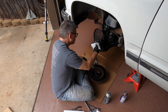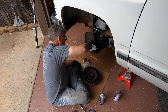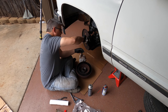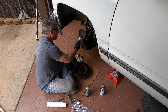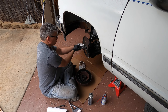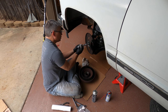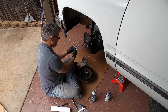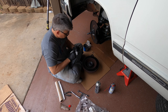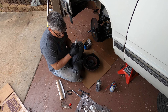One side of Betty White went together really easy, the other side not so much. This doesn't make it go any faster, but it will cut down on wear on the passenger side front tire, which was pulling to the right tremendously — hasn't been aligned in years. It's going to sit a little bit lower and look good when finished. One person could probably do this job; two makes it a little bit easier, especially when messing with spring compressors. Two half-fast mechanics don't make one fast mechanic. This may be all we can do this week, but it's been a pretty fruitful car camp.